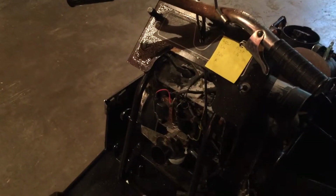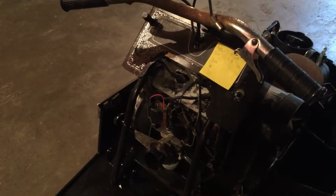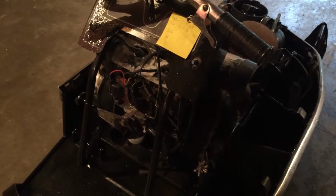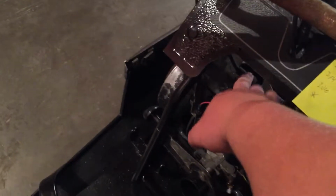It already had some new spark plugs, and I don't know if you saw the video before, but you'll have to go back and watch. It didn't sound right, and I got it going again when I put the new fuel lines in, and I totally went through the carburetor, replacing everything, and a new fuel filter again. And it just didn't sound right. It was really boggy. I had to jack the idle up really good, and here, you'd pull this spark plug wire off and the thing would die. So I said, oh, it's only running on one cylinder. So I cleaned the points again, adjusted them. They're fine. So then I replaced this coil, and the thing just runs like a champ.